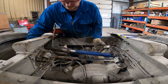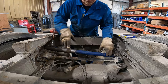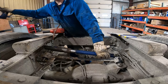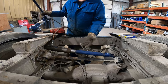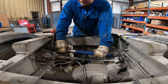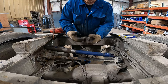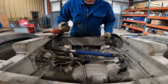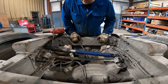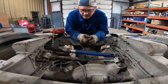I honestly have no clue how people do this stuff without these kits. This is actually a body repair kit - 10 tons, comes with all sorts of different tubes, attachments, and a nice pump. You just pump it up and it gives you 10 tons worth of pressure, so you can move axles around, shove it apart to get torque rods in. I literally use this thing every day or every other day - it is so handy for getting everything lined up. I'm not putting any effort in, not sitting there prying. You just stick it in, give it a couple pumps and it does all the work. Really cuts down on wear and tear on your body over 40 years in the mechanic field. Top tip for the day. Let her off and boom - all goes back into position.